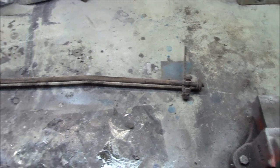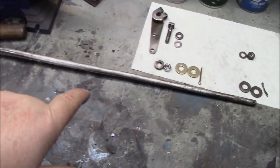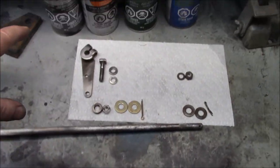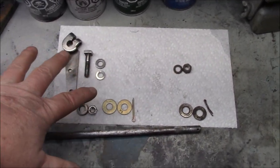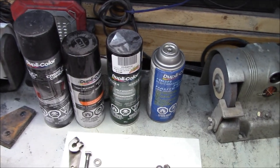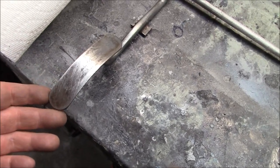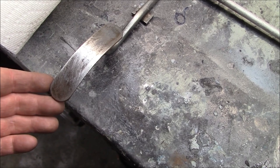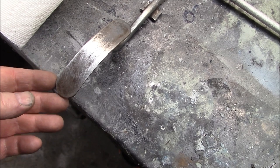The gas pedal throttle shaft assembly is now cleaned up. We've got our hardware all cleaned up and exchanged for some new hardware. We've got our paint standing by. I'm thinking of actually doing the pedal pad itself in a truck bed liner, just because it'll give it a bit of texture and durability — that paint tends to wear off these pretty quickly. You don't get a pedal pad on the TR250 gas pedal nor the TR6, so the truck bed liner is probably a good application.